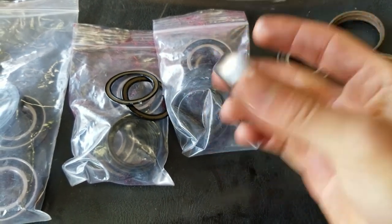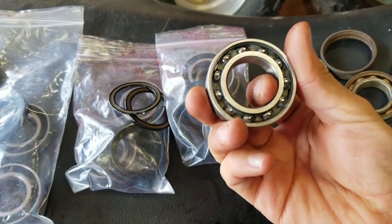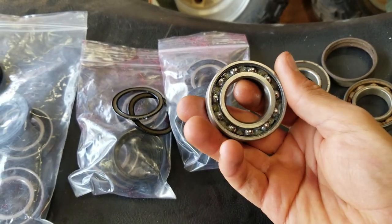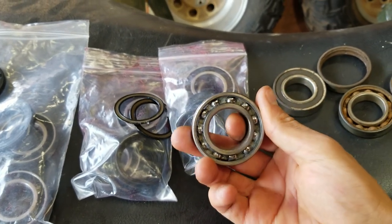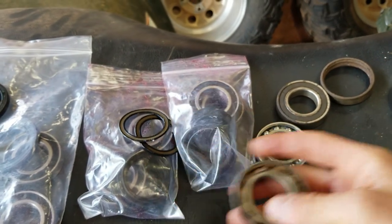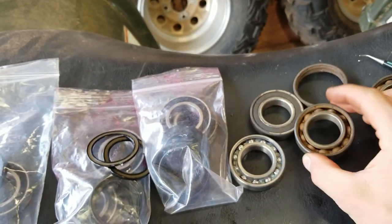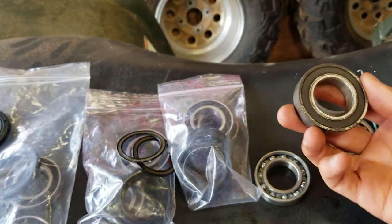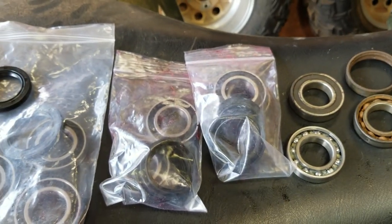Here's the other side. I've read that ball bearings are designed to be a third to a half full of grease. I'd say this one is about a quarter full. I'm going to pack the whole thing full, because I've never taken apart a wheel bearing and said it failed because it had too much grease — I've never heard that.